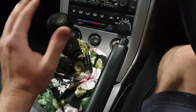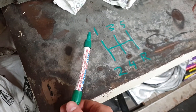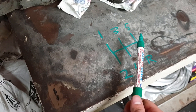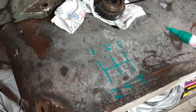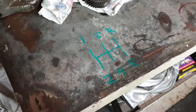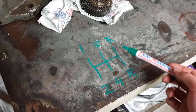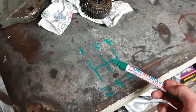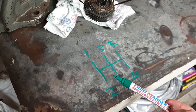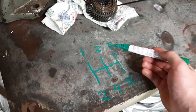I've got a gearbox on the bench, so let's go have a look and I'll show you why I think they did it this way. We've drawn our H-pattern for the gearbox: one, two, three, four, five. What they've realized is that for touge you don't use fifth because you just don't go that fast — the straights are short. The gap between third and fourth is relatively big, so there is an acceleration gain to be had by having a gear between third and fourth. Instead of replacing the whole gear set, they've just made one gear and put it into the position of fifth.